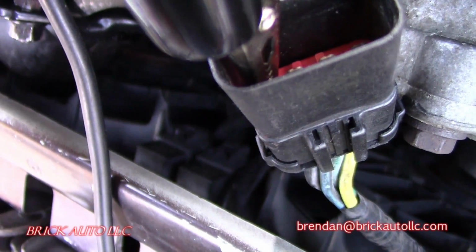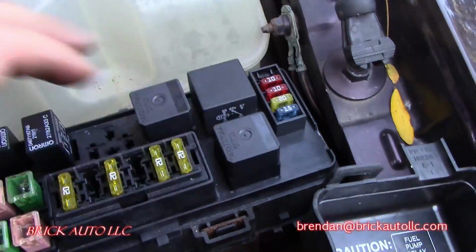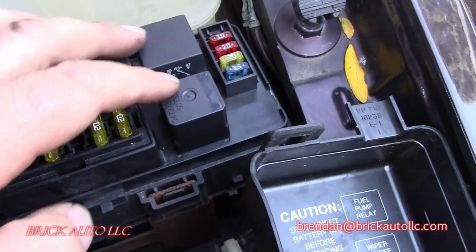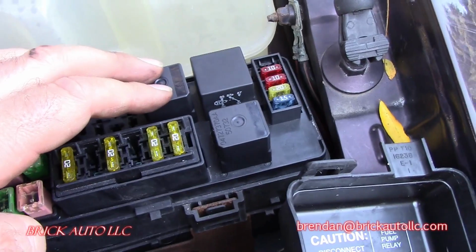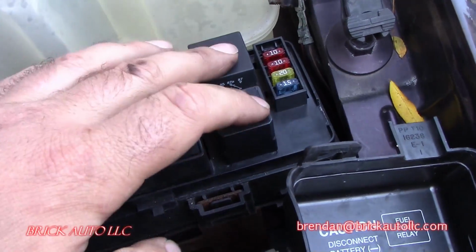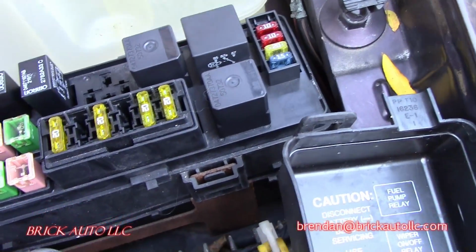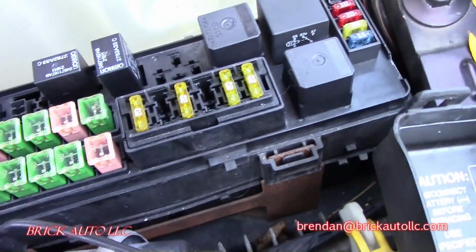Okay, this still might be kind of difficult to see, but these relays here have all tested good. These three, I've moved them around. This is an auto shutdown relay. This is the high-low relay, it's called, and this is the high relay. But they're all functioning. I've tested them. These relays themselves are not the issue. I don't know if there's a control problem, but it seems like only the high is working. You can't get the low to go.